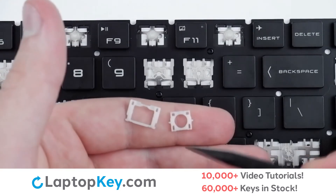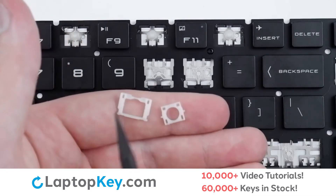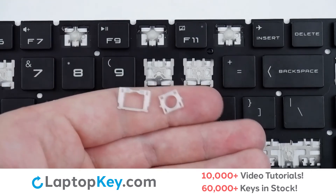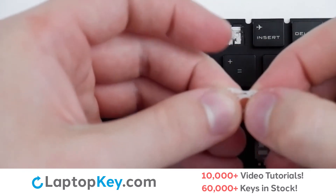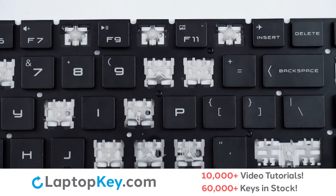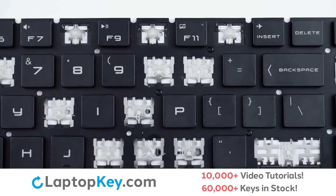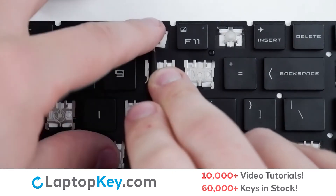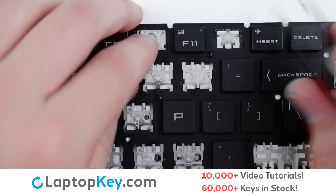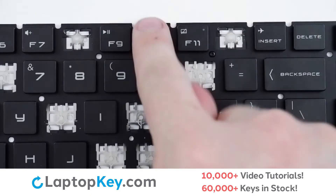To reassemble your clips, we'll begin with the top clip which has two thin holes at the bottom and two smaller holes at the top. For the bottom clip, there are two thin holes at the top with a small divot on the underside. Connect the two halves together, ensuring the plastic support arms at the top enter the holes on the bottom. Then using metal hooks here, here, here, and here, we will lay the clip down top first, ensuring it hooks on properly. Press down flat at the bottom, replace our key cap, firm press, and we're functional.